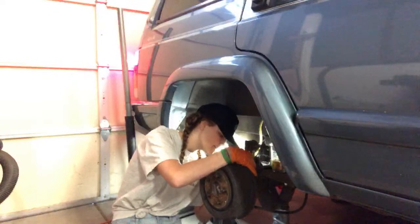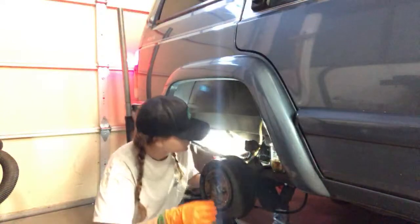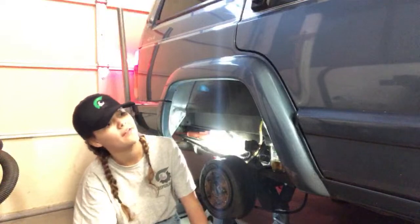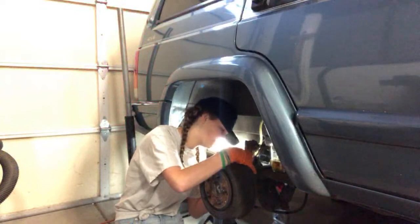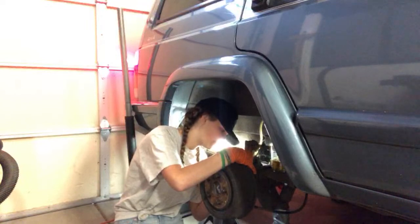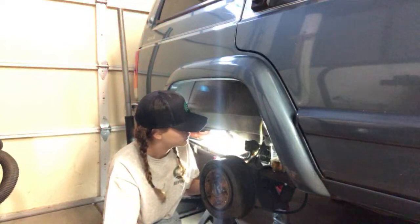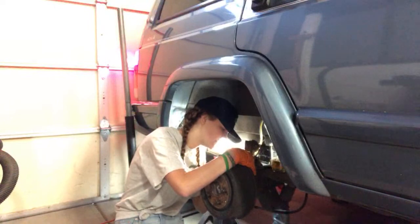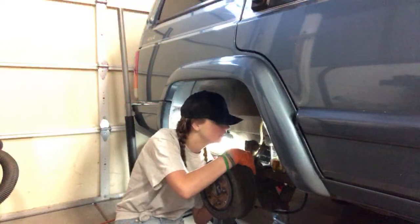Close. So when I get to the bottom of the throw of the brake, that's when I'm telling her to close. Because like I said, you can't let off the brake when she has the system open. And we're having a really small amount of bubbles now. So maybe we'll have to do it one more time. Okay, tell me when to push. Push. Okay, close. Was there any air that time? A little bit. Okay, let's do it one more time then, because we want no air. Ready? Yep. Push. Close. Okay, there was no air. Perfect.